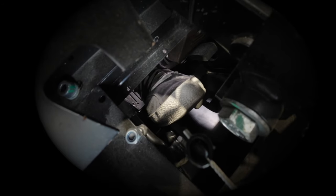What I'm checking for here is that I can get the brake pedal and that it's proud of the throttle still. So if I'm jumping on a pedal, it's the brake pedal I'm going to hit first. But I like to heel and toe when I drive, so I'm just making sure I can get hard on the brakes and I'm then just about lined up with the throttle pedal when I'm hard down on the brake pedal. That for me is my setting point.